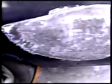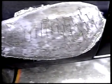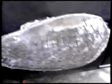Gun. We use these nails. They're loaded in the tip. We weld them to the dent. Then we use the hammer handle to yank out the dent. Then once the dent is out, we cut off the nails with a grinding disc, and then we primer and finish up. This is the same dent that we started with. That was pretty rough, pretty bad. As you can see, we've pulled it out a little bit.